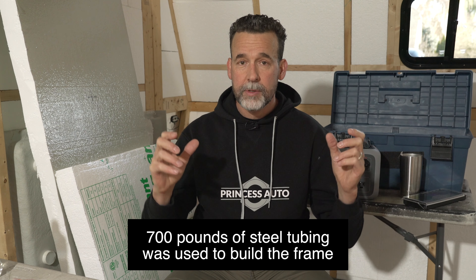So the big question about the build is how much does the trailer weigh? At this point I don't know, because basically what happened was I brought the steel, got it welded, had the metal frame welded, put some temporary brake lights on it to tow it home. It's been in my driveway ever since and I've been adding to it from that point on. I'm working on the lights right now so that I can drive it, and my first stop will be bringing it to a scale. It's on a 3,500 pound single axle, so my plan was to always bring it under that weight. It's not ideal, but I can switch out the axle. The metal frame is extremely durable and will support much more weight than 3,500 pounds. So I'm not going to sacrifice what I want inside for weight saving — if it does creep over the 3,500 pound limit, I'm not against switching out axles if I have to.